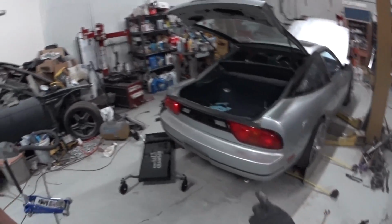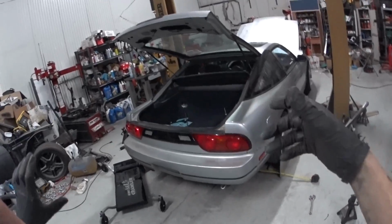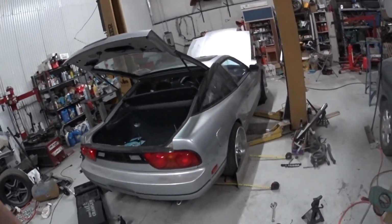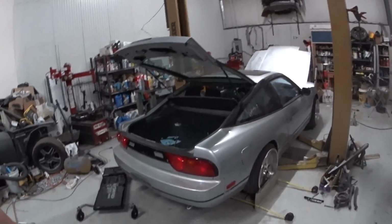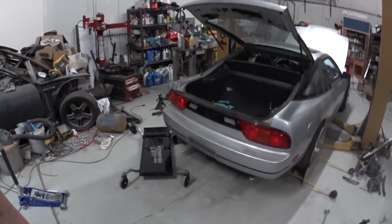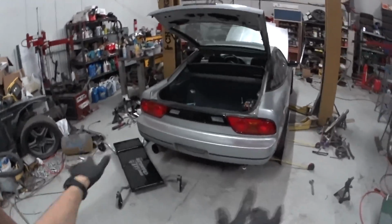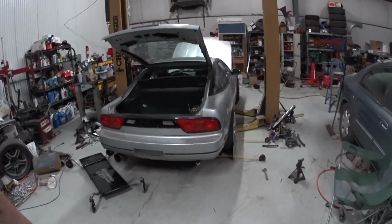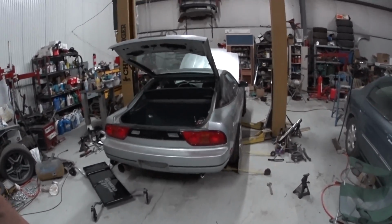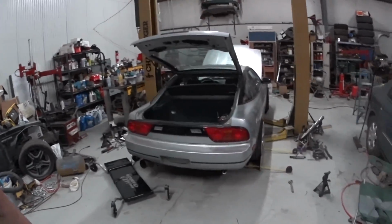just straight up and down, and basically turn it once. So basically half a turn, and it almost seemed every half a turn I did was about an eighth toe in or whatever I was doing. So it was basically extending the arms out to get the toe in, so they're opposite on each side. But yeah, I think that's about as close as you could get it, as far as basic as you could get it.